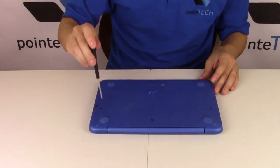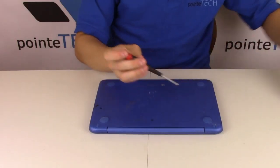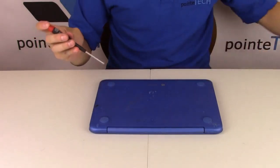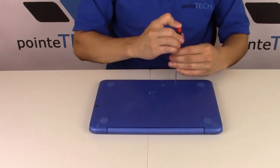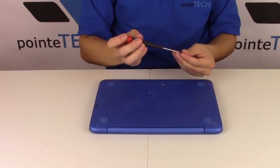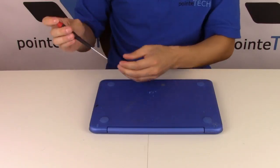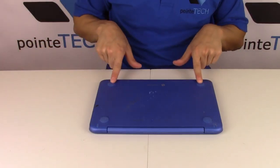There's one there, one there, one there, and then four on the bottom. Try to keep your screws together. We do it all the time so we can tell what screws go where, but try to keep your bottom case screws together and your motherboard screws together because they may not always fit each other's spot when you go to put them back. A magnetized screwdriver helps — if you don't have one, just set your screwdriver on a big magnet for 15-20 minutes.